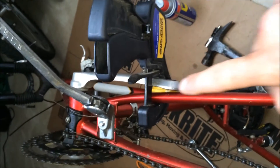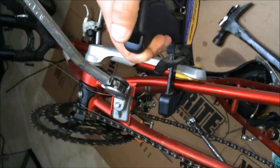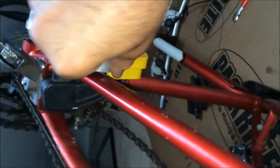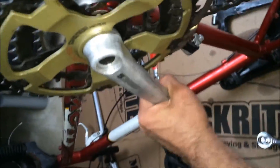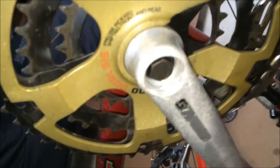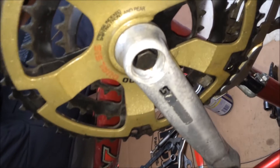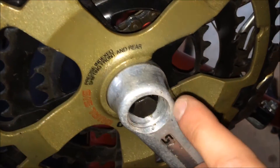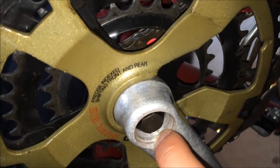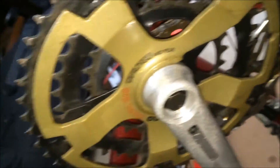The arm that I just removed, I put it back on — just slid it back on, no bolts or anything — and I clamped it down to the frame just to keep everything from moving so that I can take off this one. Again, I'm going to take off that bolt in there, then I'm going to put in my removal tool threaded to the threads on the inside of the crank arm, and I'm going to smack it with the hammer until it pries off.